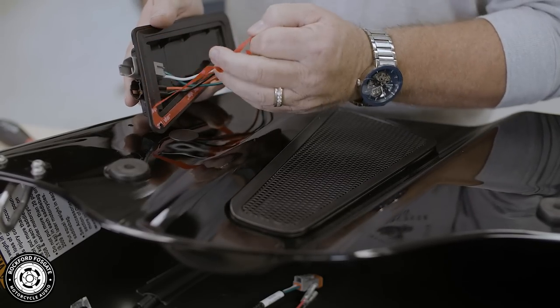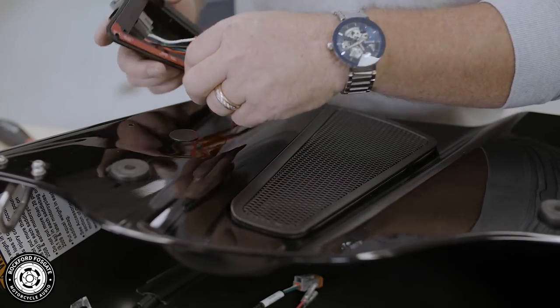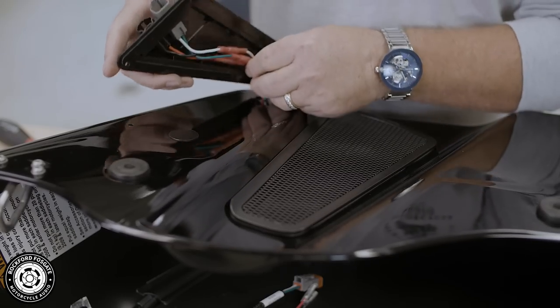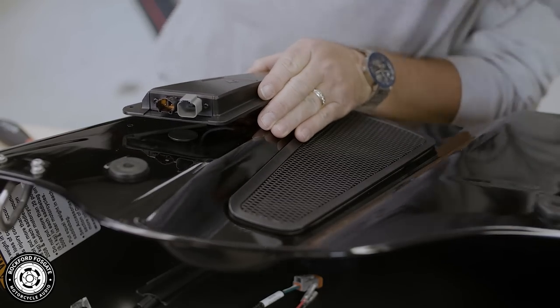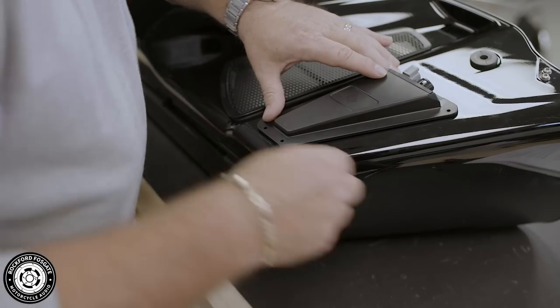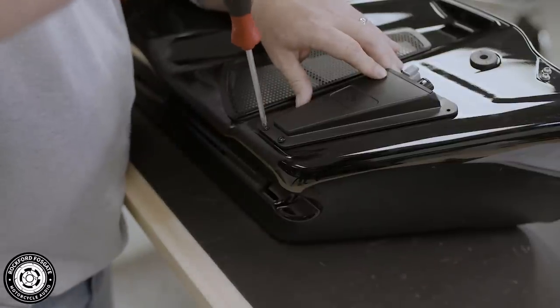Once confident with the location, peel the 3M backing tape and align the 3 mounting holes. A small trick is using a hole guide in the top, then line up the lower holes. You can now reinsert the bottom 2 screws and secure the wiring harness. Your top screw will have a washer and a nut for connection.